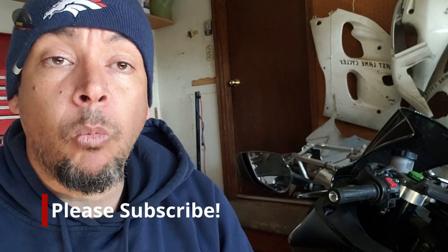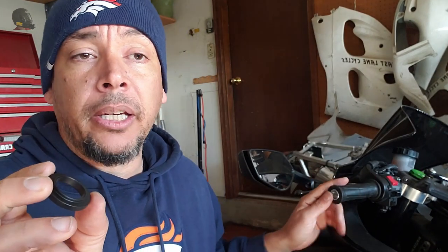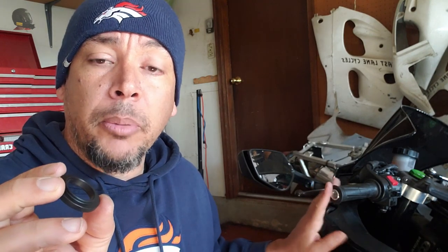So you're probably wondering what was step two. Step two is to install the thrust washer — you've got three of these in different thicknesses — but you're supposed to install it on the bar end. The problem is the throttle tube on this bike comes all the way out flush to the end of the bar, and this piece is supposed to fit over the handlebar and mash up against the throttle tube, so it can't really do that. It doesn't work.